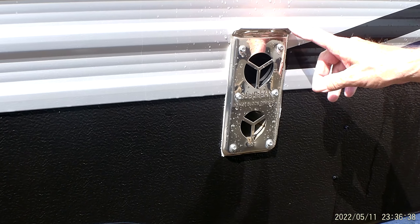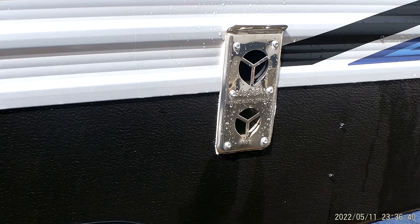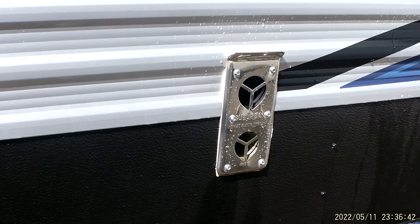Next one back is the outside of the furnace. It sucks cold air in the top and hot air out the bottom. I always suggest putting a mud dauber screen over the outside of the furnace, because once it's been lit on propane, mud daubers love that smell. They go in there, build their little dirt nests on the inside, and then your airflow is not right inside the burn chamber. That little $20 investment is worth its weight in gold because it's $145 an hour to take the hot water heater or furnace out and clean the mud daubers out of it.